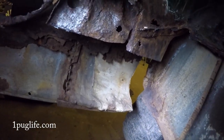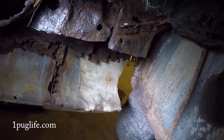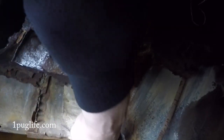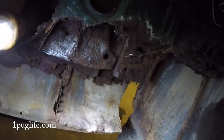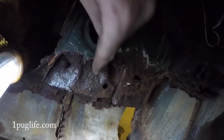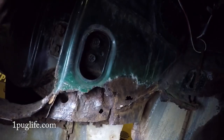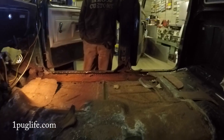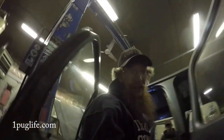They've welded the rocker to the fender right there, which is just unacceptable. I don't even know what kind of material that is — if it's plastic or metal, or metal with some skin stuff on it that they didn't take off. The frame stretch here is supposed to come down and box everything in, and then the inner welds to that. But you can't weld to that very well, so we're going to have to cut that back and start over. We can't just leave all the scabs and patch over.